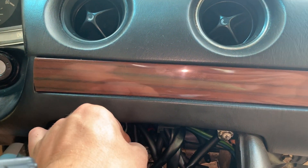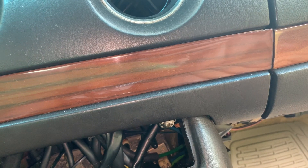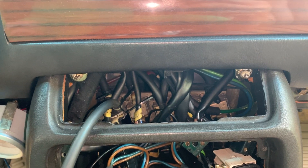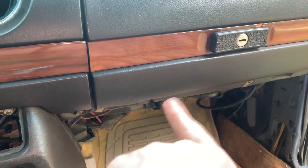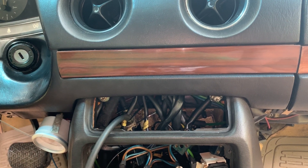We'll leave this one for now as well — it was the other end that was leaking, but it's not a bad idea to replace these ends. To test the other two dash pods properly, I'm going to have to pull the dash or at least the glove box, and I just don't want to get into that today. The main things I wanted to accomplish were the center vent, defrost, and floor vent diaphragms. I'm fine with the default settings those other two go to. Let's plug this back in and see how well the whole system does.